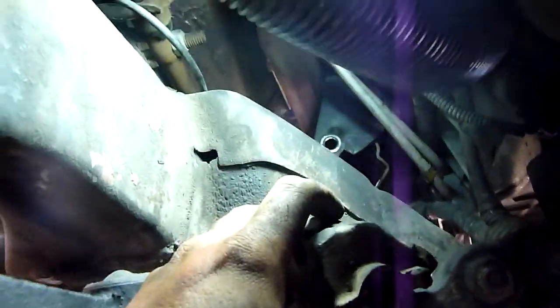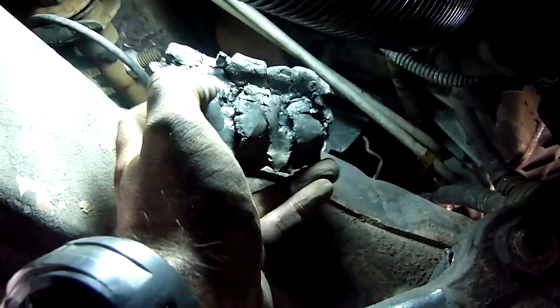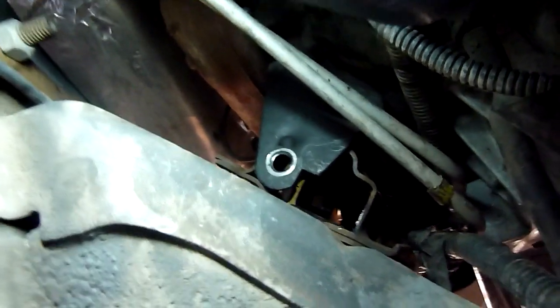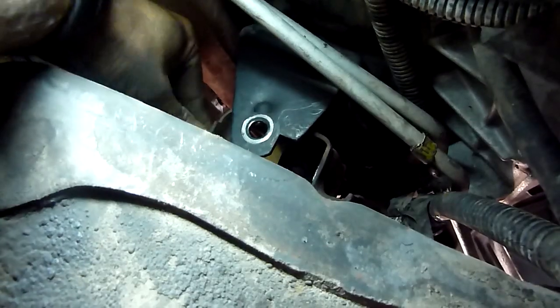I am changing the motor mounts on my 2001 GMC Safari. As you can see right here, I've got it all taken apart on the right hand side. This is basically the motor mount that fell out — you can see it's completely destroyed on this side. I have taken out the bolt that runs through the mount and then disconnected the four bolts that attach the mount to the frame, and I'll pull this out through the top.